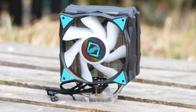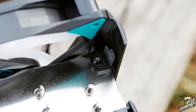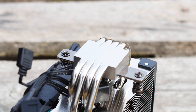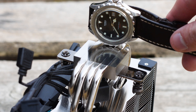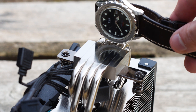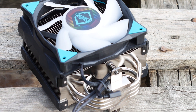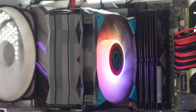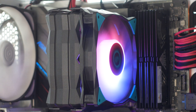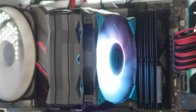The plastic mounting system for the fan also means that if you break the plastic components, it's game over — you would need rubber bands to keep the fan attached to the heatsink. Another shortcoming is the direct touch baseplate, which looks good and is well made, but will never perform as well as a solid copper baseplate — that's why high-end air CPU coolers use solid baseplates and not the direct touch design. If you can move past these shortcomings, then the IceLit G4 OC might be your cooler. It's good looking, well made, and performs well for its size. However, don't expect to overclock with this CPU cooler — it can't handle that much heat using just one fan and four heat pipes.